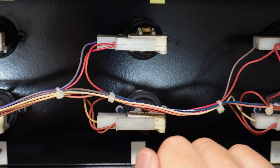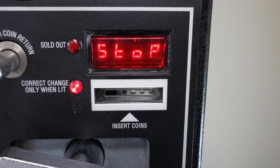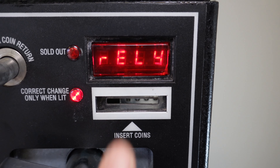I fixed selection button three, so that's our entry key. Pressing selection button three, we should get ENB on the display — and there it is, ENB. Now what I'm looking for is the relay test, so we're going to look for RELY. Pressing button one to advance — and there we are, relay. I'm going to press selection button three — top row, middle button.